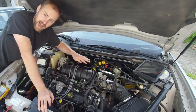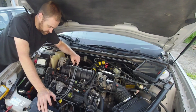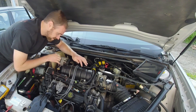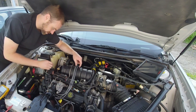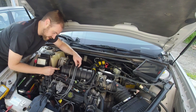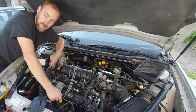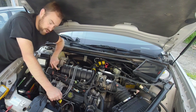A short can cause high or low voltages depending on where the circuit shorts. The signal wire I believe is the green one. It says right here: five volt, out, ground. I miss these older cars — they always tell you what is what right on the car and their diagrams are so much better. So we have five volt, the out is the center pin, and the ground is this orange wire over here. If our five volt was shorting to ground, we would have a low voltage concern.